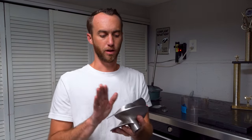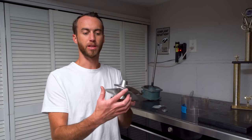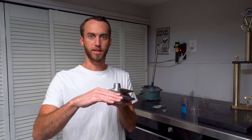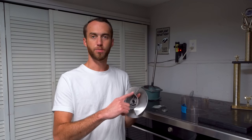Here is your basic impeller. This is a 160 millimeter pump, a custom freestyle impeller with an 83 millimeter hub, and it currently measures around 9/15 or so. When you're looking at impellers, there are two numbers when you go to order one. The first number is always going to be the leading edge — the angle that the first inch and a half or so of the impeller is at. The second number is your trailing edge. Sometimes there will be a third number like +75, C75, or +83 — that's the hub size, which is decided by what pump you're running.